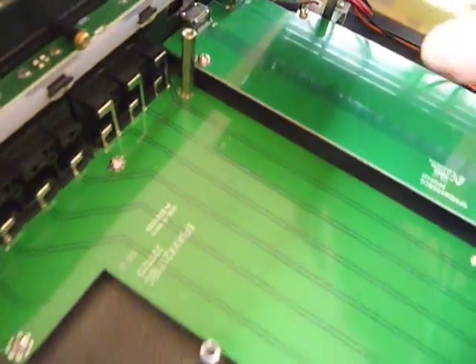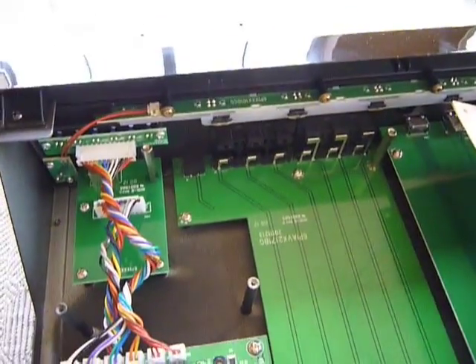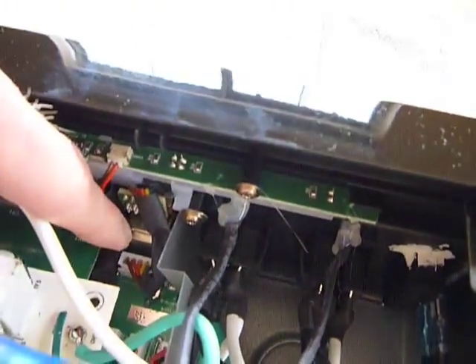None of those appear to have any sort of surge protection or power conditioning from the front to the back — not that you need it, just showing that it doesn't necessarily have it. And finally, just a look at the front USB power port connections. Those are connected up to this area here underneath the plastic. They just have an internal transformer to convert it to USB.